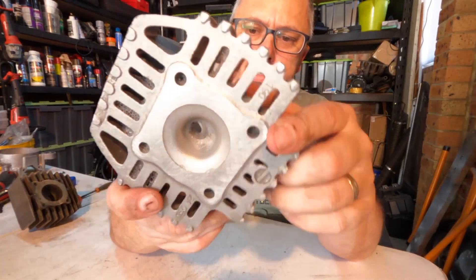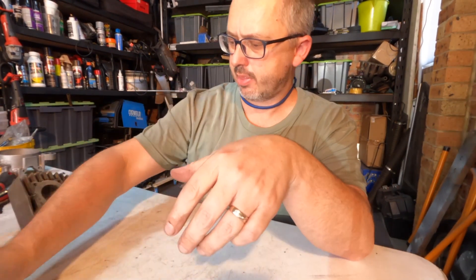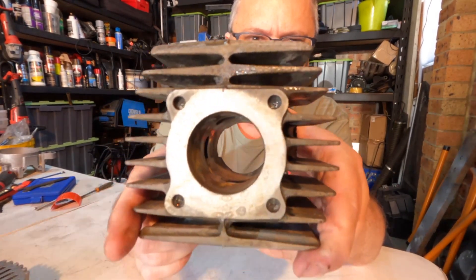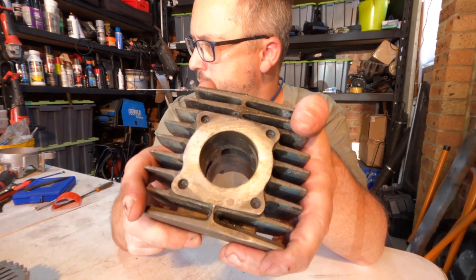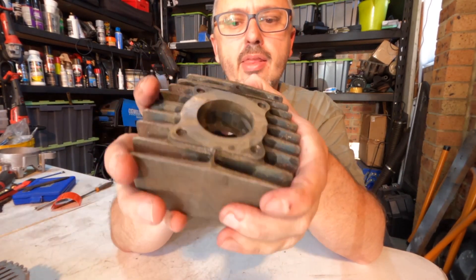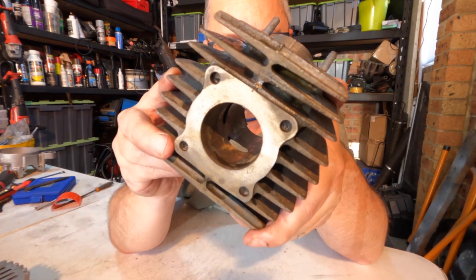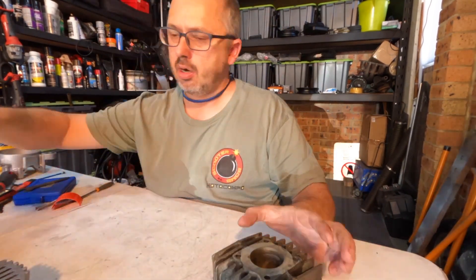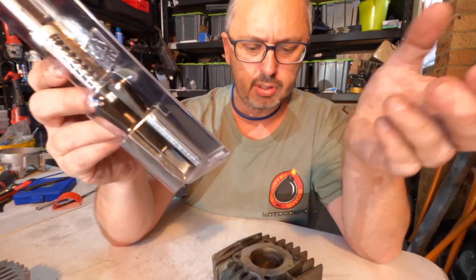Here is the cylinder head — this was actually pretty flat, I'm quite surprised. But the cylinder itself was not, so it's pretty good now. We've got two more steps before this motor is ready to go back together: one is to paint this cylinder so it won't rust, and the other is to re-hone it. So we'll re-hone it first. To do that I've bought this little tool here — it is a brake cylinder honing tool.